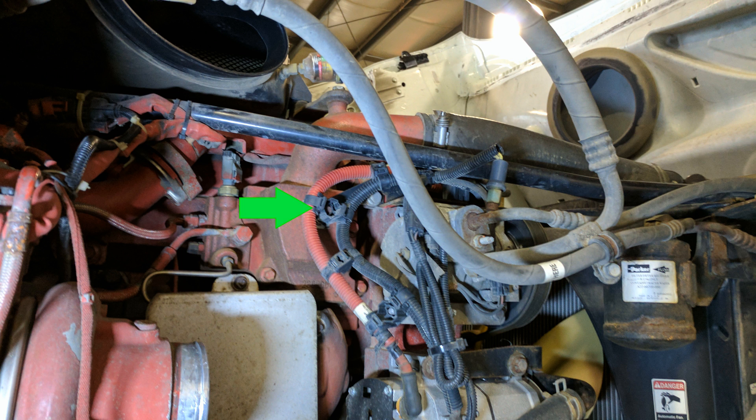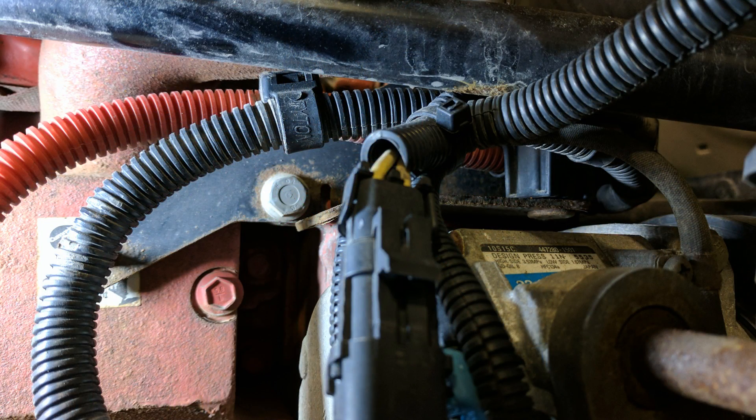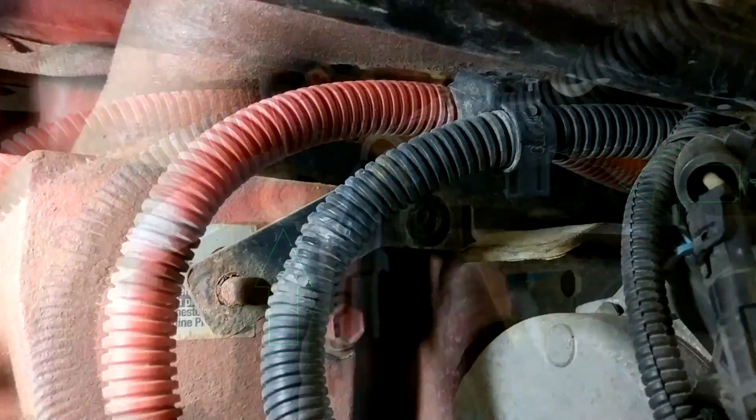We just have to move away some of the other cabling and wiring that's in the way. First we can remove the plastic tie holding the alternator cables right in front of the thermostat housing. Then the bracket that these ties are attached to is screwed in just above the AC compressor. Two bolts will remove this bracket — here is a good view of one of the bolts. We don't need to totally remove it; we just need to loosen it off and push it out of our way later on.